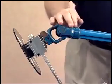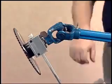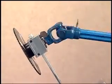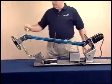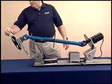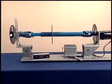Earlier in the program, we talked about phasing. Drive shafts that are not in phase do not rotate at a constant speed. Even when operating angles are equal, improper phasing can create a non-uniform velocity in the drive shaft and a torsional and inertial vibration. This is why Spicer recommends marking the components of a drive shaft before taking it apart.